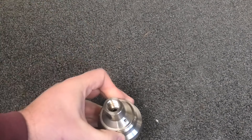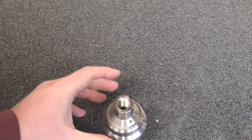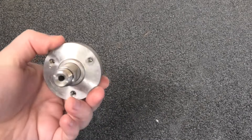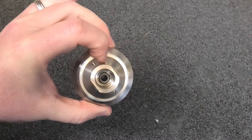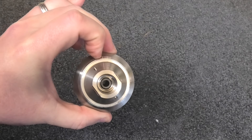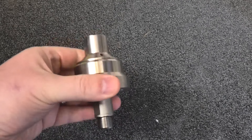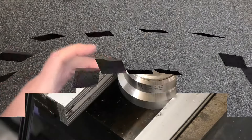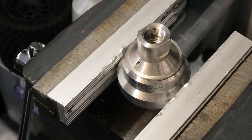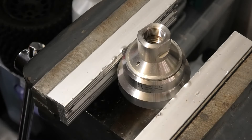The only way I found was to get it into a vice, clamp it up, get it nice and warm, and then crack off the top nut — I think it's about 22 mil — and that should loosen it off without too much aggravation. So you can see inside there: there's the top of the carbide seat — be really careful of that — and on the bottom there's a very small o-ring which basically seals the extension piece for the spray arm. Let's get this clamped up in a vice. We've got it clamped with aluminium jaws; this should hold it nice and tight without doing too much damage.